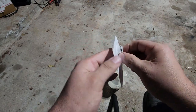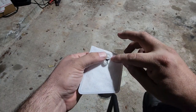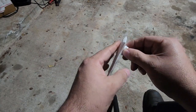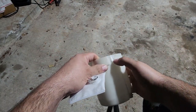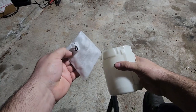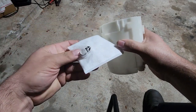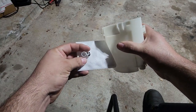That's really cool. And if you try to jam this strainer in there, you are going to smash it completely down. So you're going to hinder the hole at which the Walbro 450 can actually pull in fuel. And that seems like more of an issue. So if you do the trim, like I've seen people talk about online, they say like 3 millimeters, you trim up a little. You can put this on and fit the fuel pump in there, but this will be jammed completely against the bottom of the housing. So if you are comfortable with your fuel pump, you know, obviously you're doing a Walbro 450 to make a lot of power.